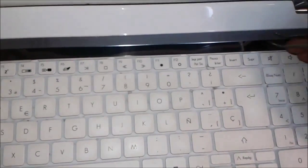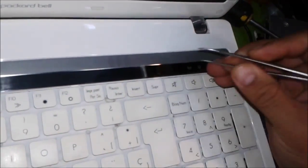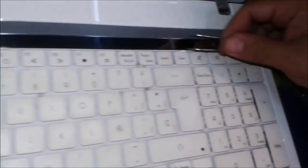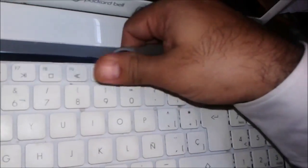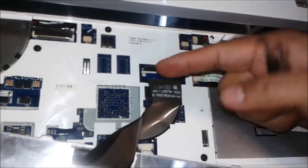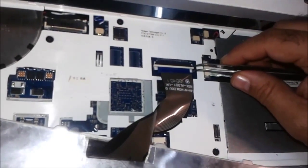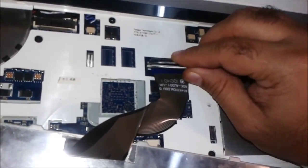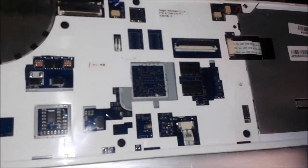On the upper side, the keyboard has some small clips inside. Just push inside and the keyboard can come up. You can see — this one is clipped, this also clips in, and the keyboard will slowly come up. This is the easy way to take out the keyboard. The cable has a different type of jack — some jacks you pull up to open. You can see the legs on the right and left corners of this jack — you have to pull forward on both sides, then the cable comes out easily without breaking the jack.